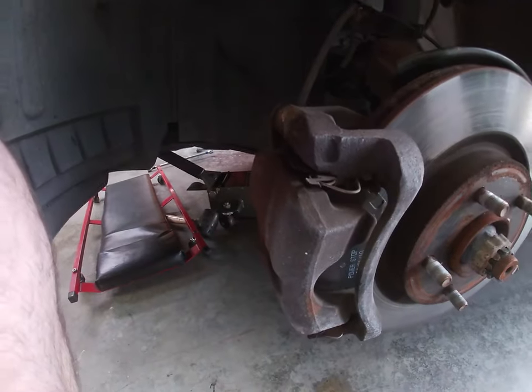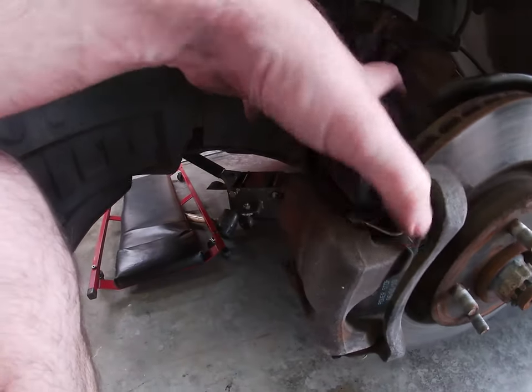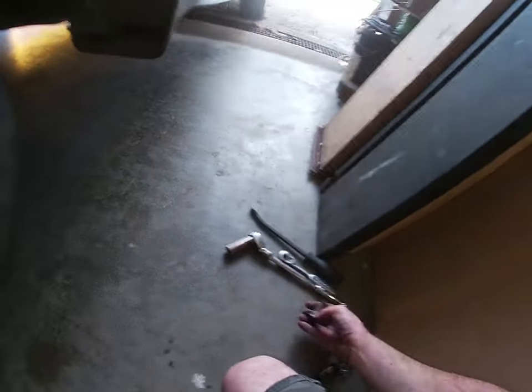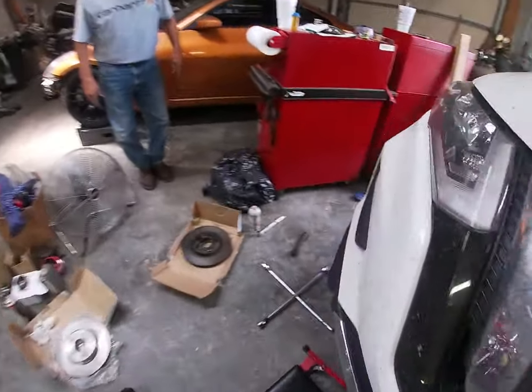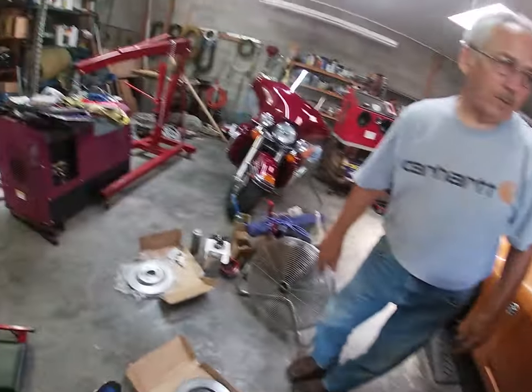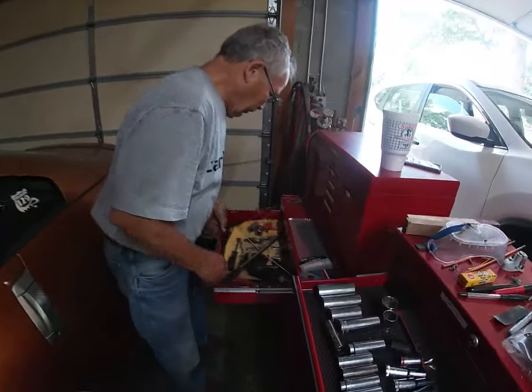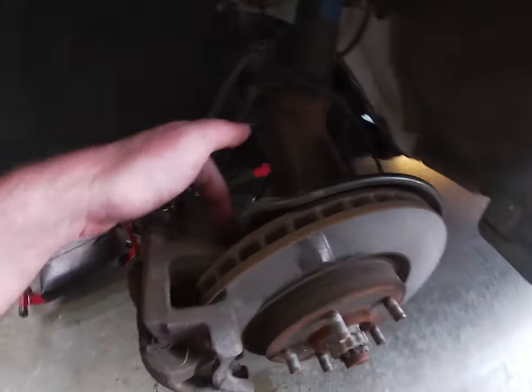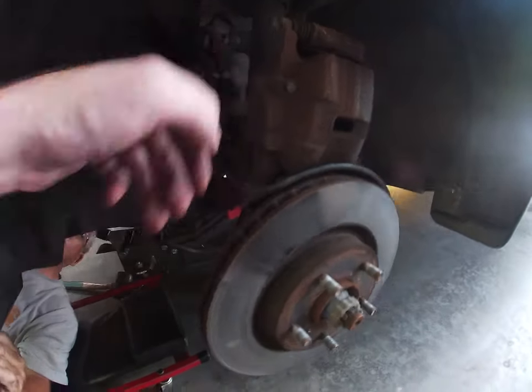As you can see, we got the car up in the air on jack stands with the wheel off. If you are just changing rotors and not pads, you can take the whole caliper assembly loose. It will have two 19-millimeter bolts in the back — one on top and one on the bottom. If these have never been loose, they're going to be super tight, so we soaked them in PB Blaster and then used a big breaker bar to break them loose. It took both to get them free, so just be cautious — those will be ungodly tight.